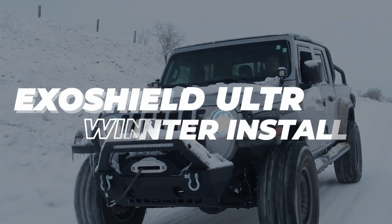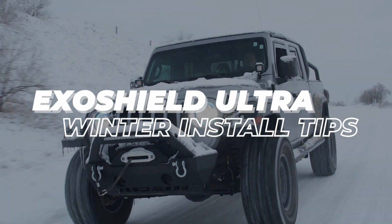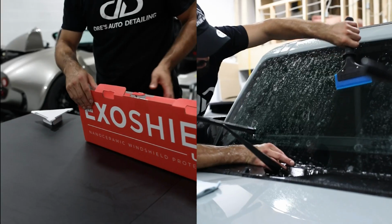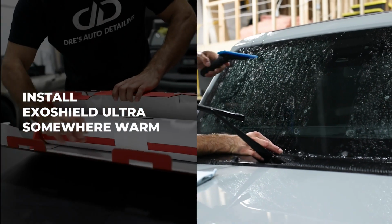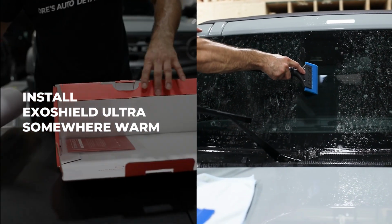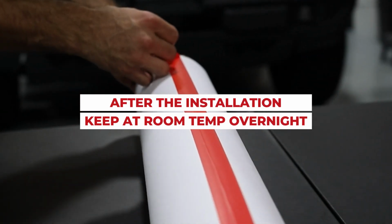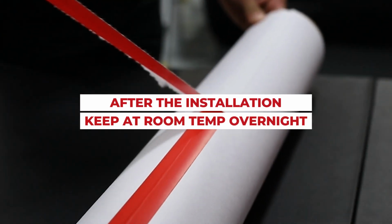In this video, we'll run through some essential tips you've got to know if you're thinking about installing your ExoShield ULTRA in cold weather. The first thing to keep in mind is that ExoShield ULTRA is best installed in a warm space, somewhere that you can bring up to room temperature during the installation and keep around 70 degrees Fahrenheit or 20 degrees Celsius for 24 hours after the install.